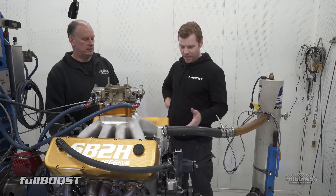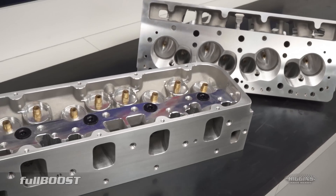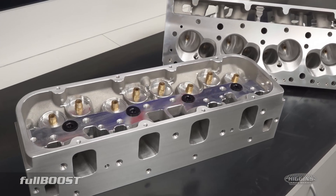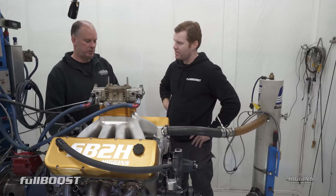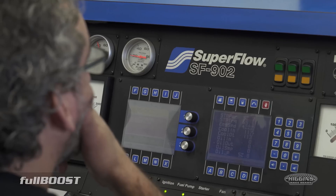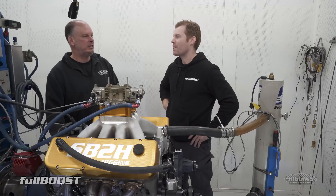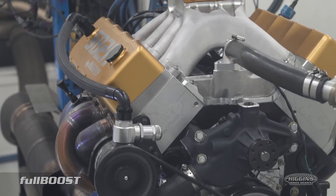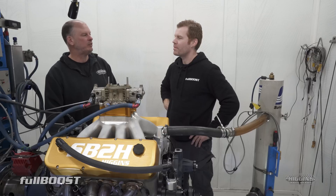Like your Ford stuff, this is a conventional head, meaning it'll go onto an aftermarket Chevy block. The one we're testing today — over the last two days we've been testing, putting this through its paces, it's had a few pulls. The bottom end is a Brodix block, PRP crank, Molnar rods, off-the-shelf CP pistons. Everything's pretty much off the shelf that most people might find in their cars.